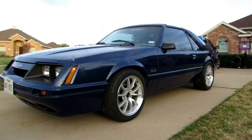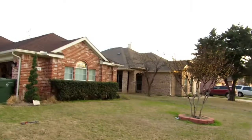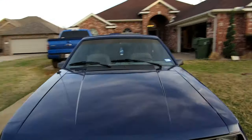And at first, the brake pedal was way too stiff, man. I wasn't really happy with the brakes at first, but I read that you need to bed in the brakes really good. So I did some pretty hard runs on it yesterday and stopped on an open road, found a good spot where I could just hit the brakes and slow it down. And the brakes all of a sudden started biting really hard, and then it was able to lock up the wheels, no problem. However, I've got to adjust the bias, the back wheel locked up. And I'll show you guys this here if I can.